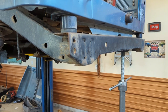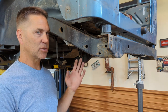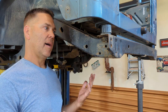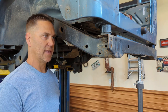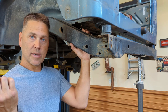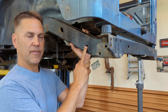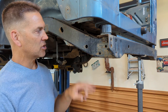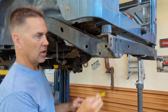Figuring out where to place this cut can be tricky. We measured a bunch of things, ran a string across, made sure it was even on both sides and perpendicular. I measured probably 15 to 20 times to make sure everything would be a repeatable measurement. One nice thing was being able to compare this Jeep to my old Jeep. The one thing that's absolutely consistent is this hole right here — my guess is it was used in the manufacturing process with some sort of jig.